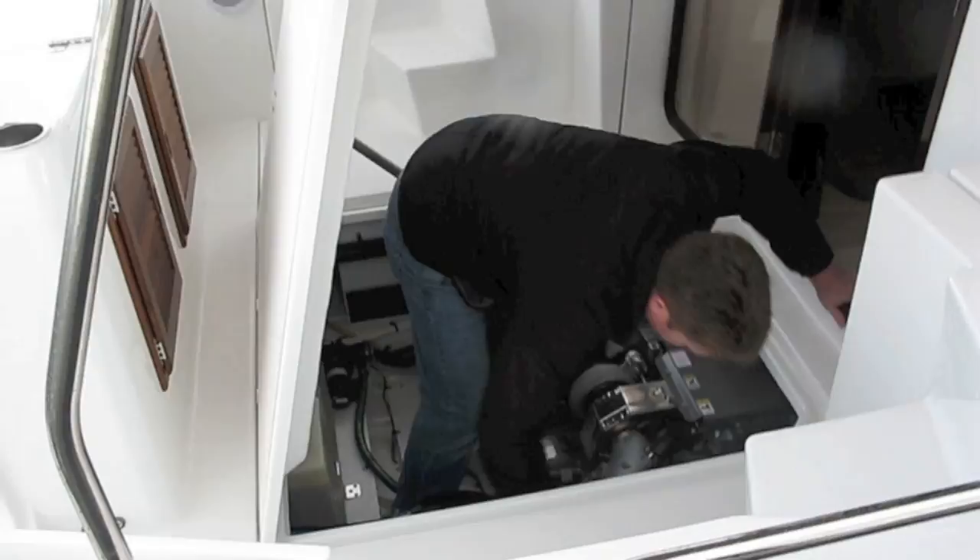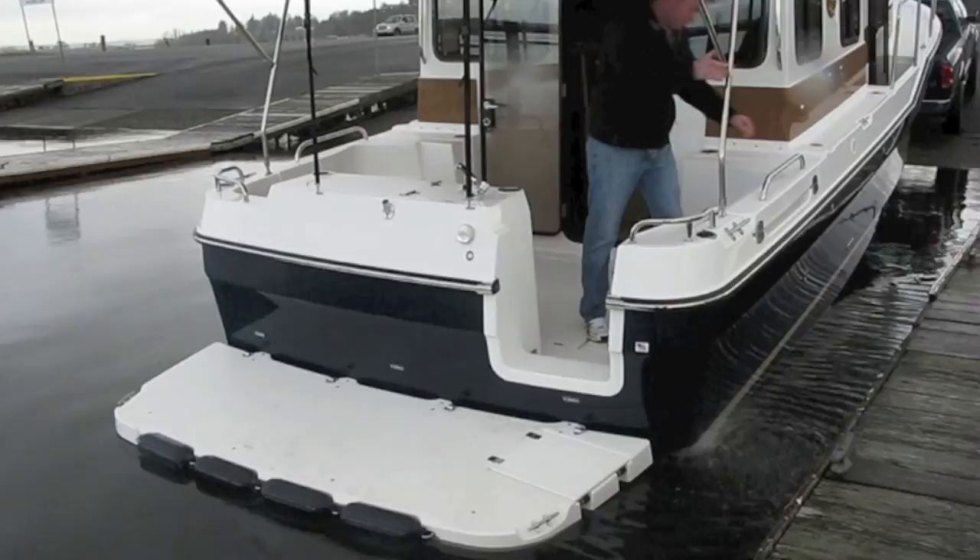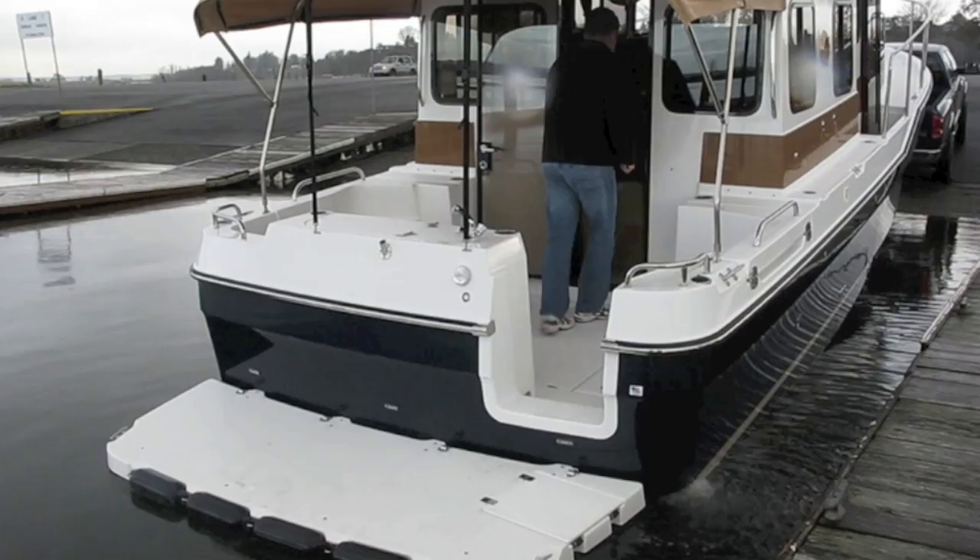John's turned the battery switches all on and he's now opening the seacock. The seacock is now open, which allows water to flow to cool the engine. We get more calls about impellers burned out from a closed seacock, so John's confirming that we've got good water flow before he backs the boat off the trailer.